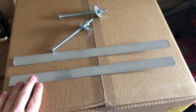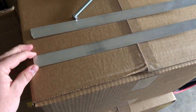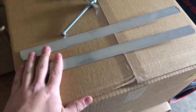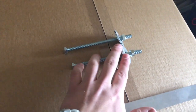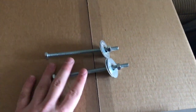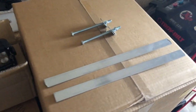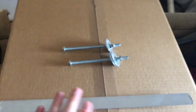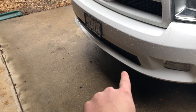For this installation you are going to have to build the brackets yourself. What I did was get a piece of three-eighths inch thick aluminum, went and cut it at my buddy's house, cut it to about the length I need. I got two really long bolts because this is what's going to attach the aluminum to the frame. A couple of washers — they've got to be this long because the frame is boxed all the way around, so the bolt needs to be long enough to go through one side and out the other.